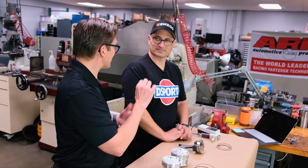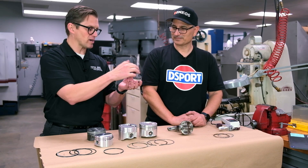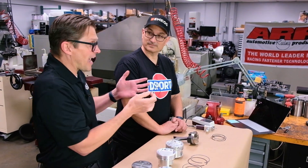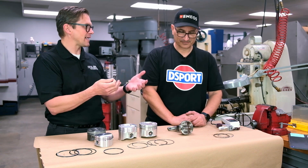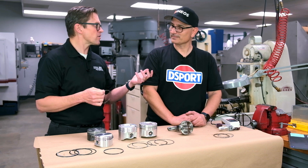Be it stainless steel or iron — if there's a chunk of debris in the engine, engines make metal during break-in. In fact, there's usually three or four times more wear during break-in than at any other time of that engine's life. We can see it in the used oil analysis.